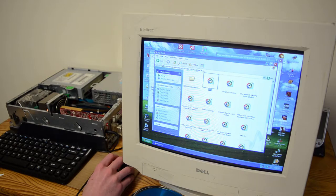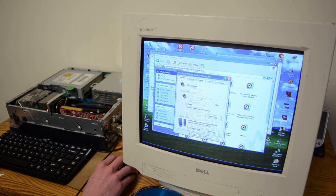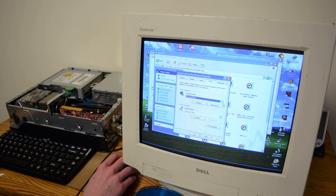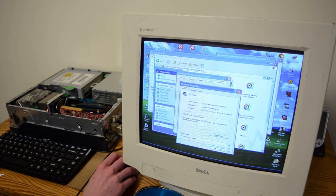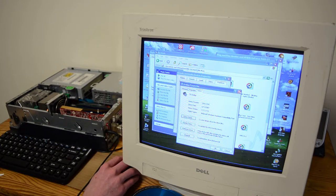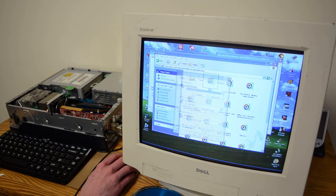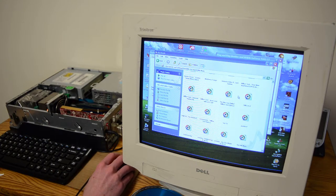Alright, that's pretty nice. Now, of course, because it's working, the sound card is selected, but here we go, Sound Blaster Live 24-bit. I just want to make sure that everything is set to it. Creative Sound Font Synth. Interesting. So that's what it's called. Then, Sound Blaster Audigy. And then we're using this driver from '07. Now, our Realtek isn't even showing up on the list of audio devices, which is interesting. Did it just disable it when a better sound card was installed? Did it just give up? Let's see, I'll try something else.